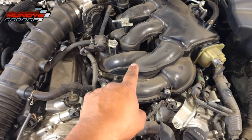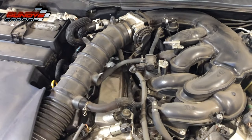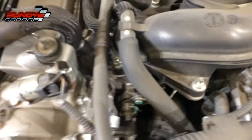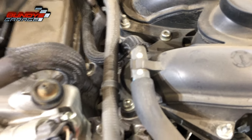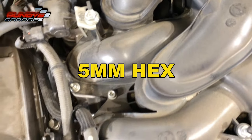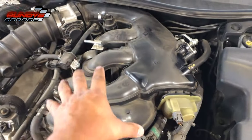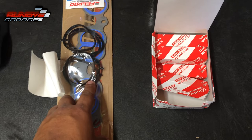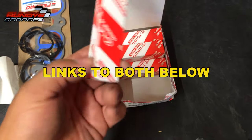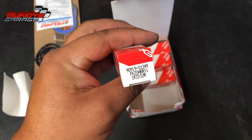Here's the upper intake manifold that has to come off. You'll need to take off the throttle body — there are four 10-millimeter bolts holding it on — and remove the snorkel to get access. There's a line here that needs to come off, 10-millimeter bolts down here holding the plenum, allen screws on both sides, and fuel lines over here. It's a good idea to change out the plenum gasket when you do this. Got the plenum gasket here with three individual o-rings, and Toyota iridium spark plugs, part number FK20HBR11.